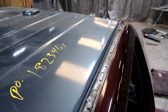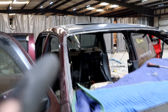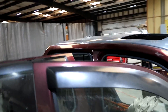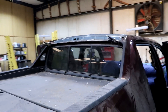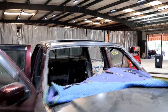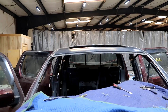This thing fits absolutely perfect — everything just lines up like it's supposed to. I think I am good to start welding. I actually cleaned off the metal before I test fitted it so I don't have to take it off again, since I'm by myself and it's kind of tough to take this roof off and install it back on. This thing lines up really good. I'm actually very happy with how this is turning out. The roof is finally welded, everything looks really good, I've grinded it as well. Now all I have to do is apply some seam sealer and let it dry.